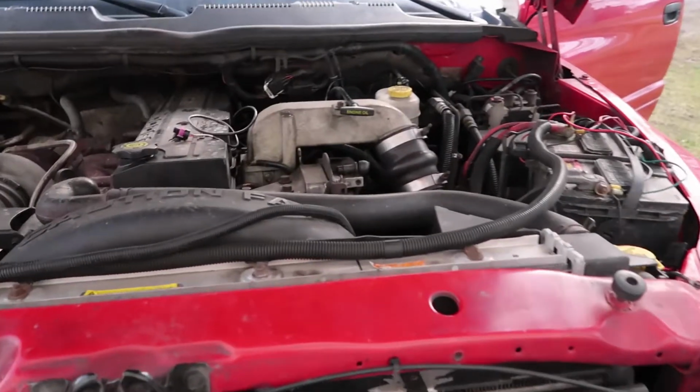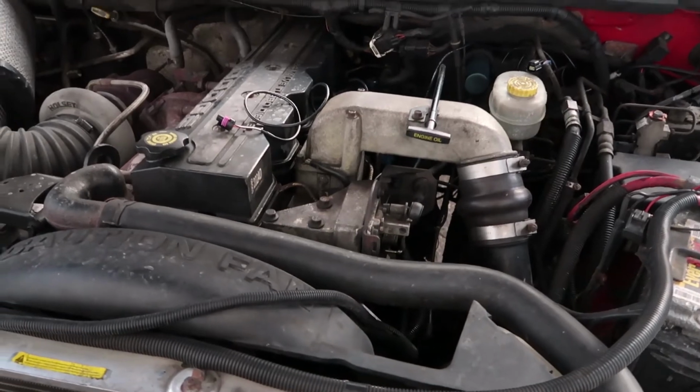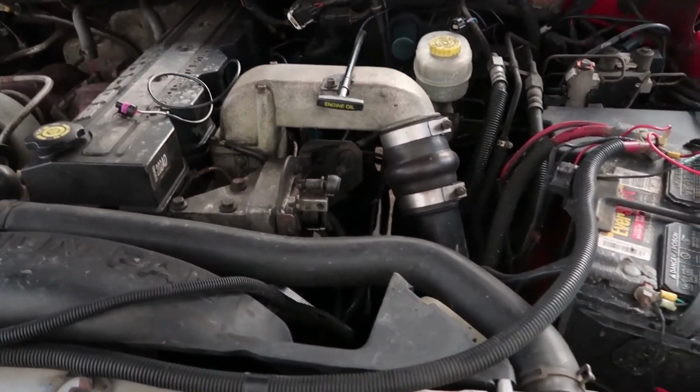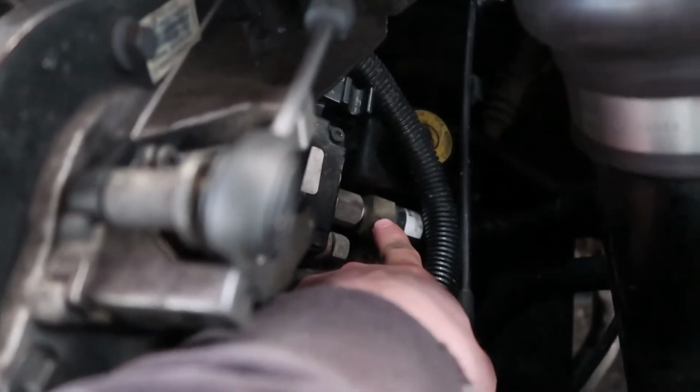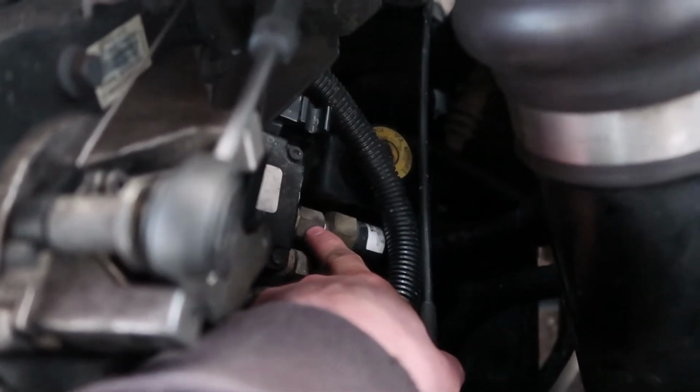And then we can go ahead and attach our boost bolt adapter. We can get the fuel pressure snubber valve and sensor all put together, get that BD low fuel pressure alarm out of the VP44 right down there. So we'll be removing this BD low fuel pressure alarm that is in this banjo bolt going through the feed line of the VP44, and that's where we will hook up our fuel pressure sensor.